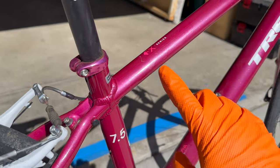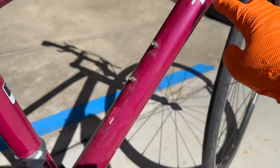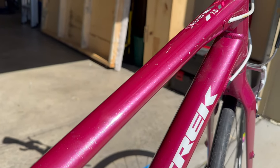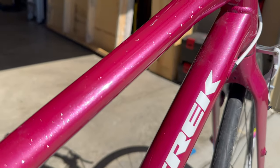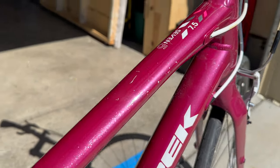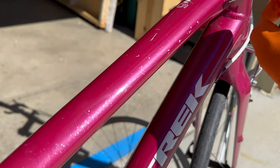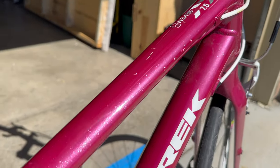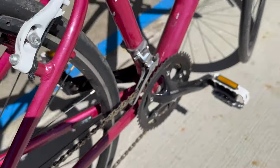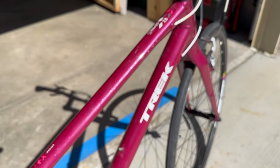We have the frame out here in the sun. You can see some scratches and dirty spots here — this is original, untreated. I wanted to show a before and after with that spot test. You've got dirt here, and when you look at this portion right where I did it, you can see it brings out a high level of glitter. Yeah, you see the chips, but that scarring from the clear coat is pretty much eliminated — so it's less noticeable. This scratch goes all the way to the actual frame metal underneath, but you can see what it did look like before. That's what you can do to really get those frames to pop and come back to life. I'll proceed to finish this frame up and get all those little scuffs as well.